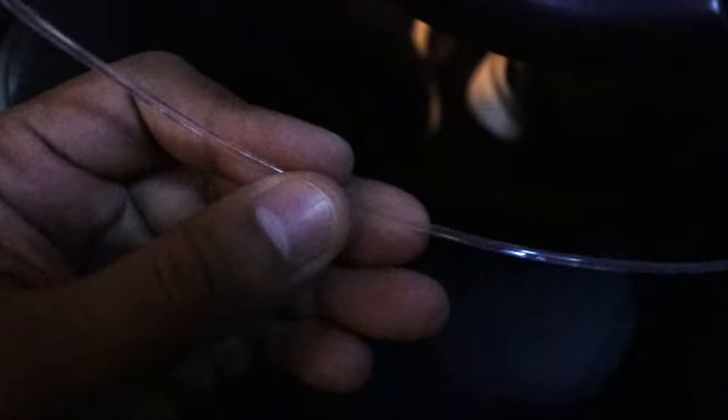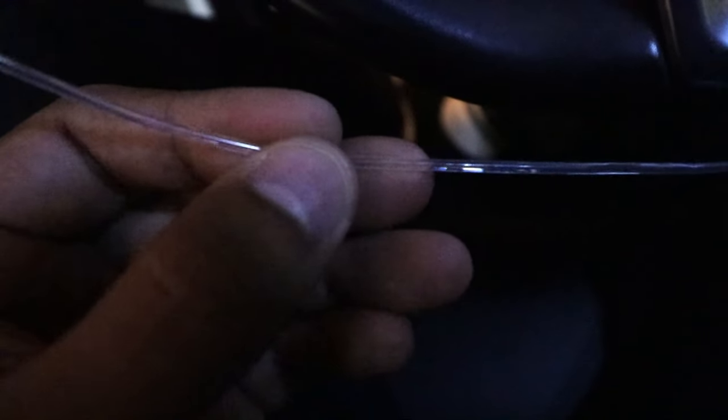Also when it's not lit up you can see little white lines in the clear tube — it just doesn't look good at all to be honest. It makes my wife's car look really cheap. Here's a better look at the fiber optic when I removed it out of the sheath. See how it's kind of reflective in certain spots — those are all little micro-cracks inside the LED tube. You can't really do anything about it, it's just really bad quality. Those little cracks pick up on the LED light and give it really dark spots and really light spots throughout the whole strip.